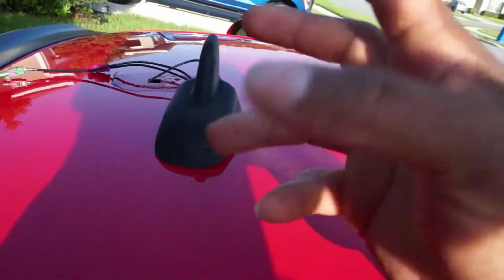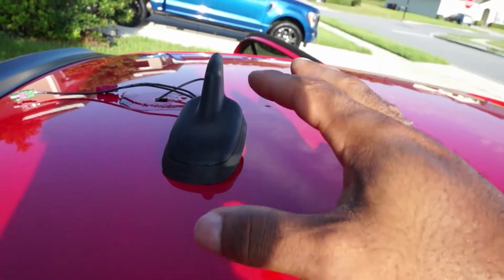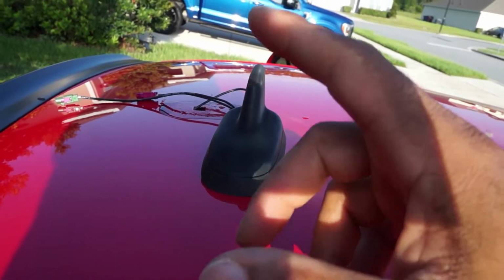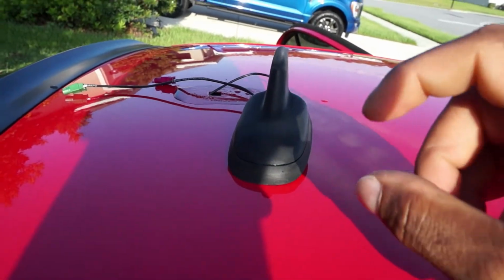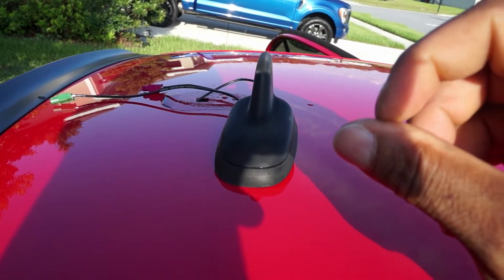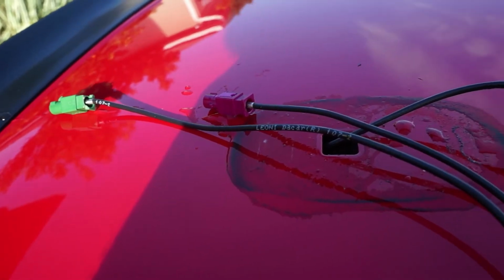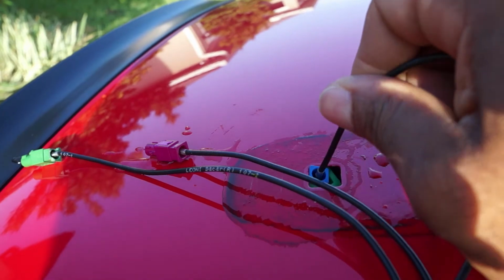Well, there's three plugs, green, pink, blue. They have another clamp on top of them that keeps the connectors together. They're color-coded, so there's no wrong way to connect them. But you do have to get three of them. It's a little bit tricky, not being able to see, but on the back of the connector is a small little tab that you just press and pull. As you can see, that green piece in there, I think you can see it. It's still on the connector, that's why it's too big for me to pull out.